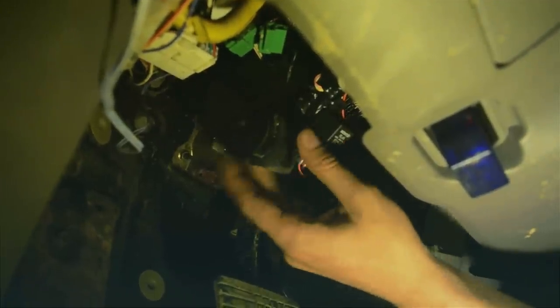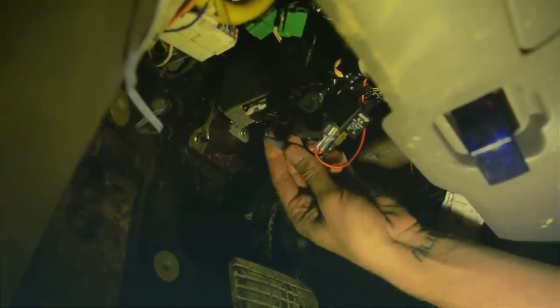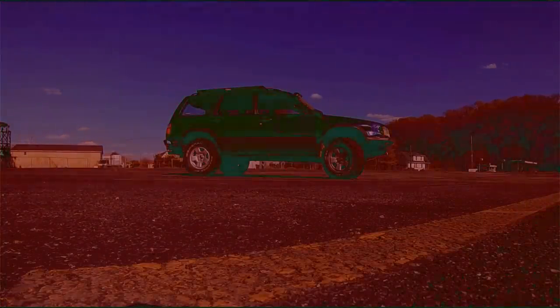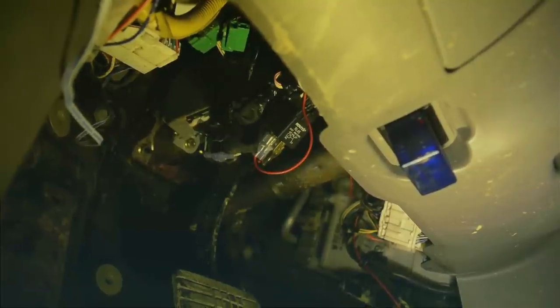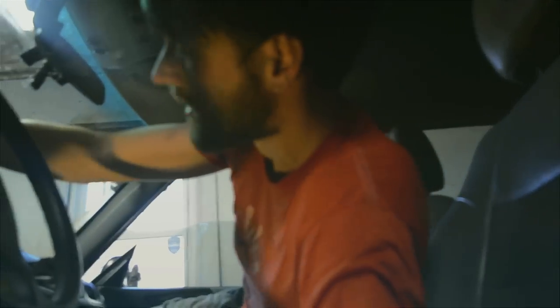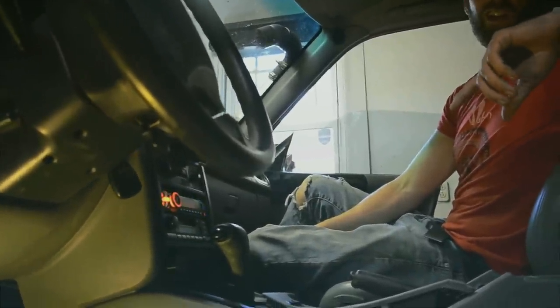But I didn't get that fancy, so it's either just off or on. The other half of this equation is that the TCU - you see this white wire connected up - that goes up to a resistor. It's a 15 watt, I think around 15 ohm resistor, so it's like a little less than an amp going through it. Basically that's so the TCU doesn't go into limp mode, because if you leave that wire disconnected at the TCU side, it sees no current being drawn, thinks you have a wiring failure - that you're not connected to your transfer solenoid. You put that resistor in there to fool it into thinking the solenoid is still connected.